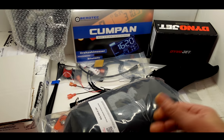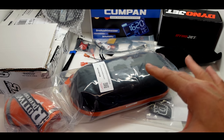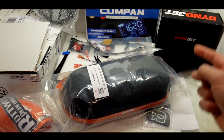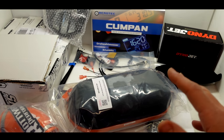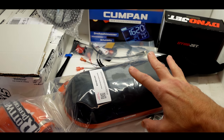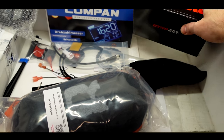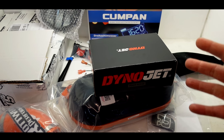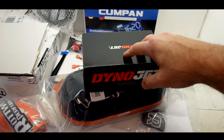We've got the full Rottweiler air box kit for the 690. I had one of these on my 1290 Super Duke and it made a massive difference to the pickup of the bike — these give so much more torque lower down the rev range. The 690 is a little bit asthmatic below about 3,000 revs, so I'm hoping this produces torque low down and gives it more top end. To go with the Rotti kit you need a power commander, because it changes all the fueling significantly.